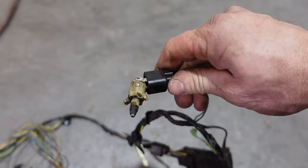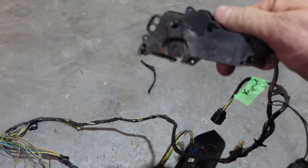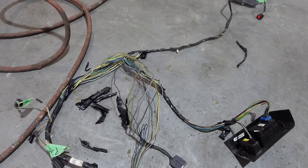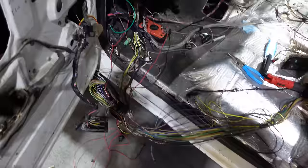For the interior light, it works exactly the same as what's in the door — I just need to connect those two wires. We also have one more plug for keyless entry, but I don't feel like cutting into my door and putting the keypad there. We don't know the code, the previous owner doesn't know either, and I'd have to go to Ford and prove we own the truck — not worth it. We'll clean up that wiring, tie it all in there nice and neat so we've got power windows and power door locks.